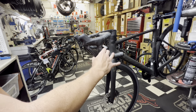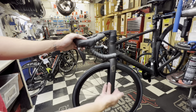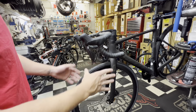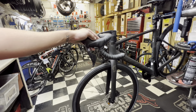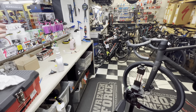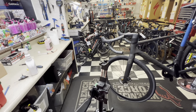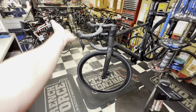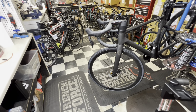Give the brake lever a squeeze — it should feel great and dead solid, not spongy. Sometimes if you're pushing fluid through a brand new line, it might feel soft at first, so give it a couple of pumps and it should settle in. If it still feels spongy, there may be some air in the system — go ahead and bleed it one more time. And that, my friends, is how you bleed a brake. This same process applies to the new Shimano Ultegra 12-speed, new Shimano Dura-Ace 12-speed, and I believe the new Shimano 105 as well. Any questions, leave a comment below!